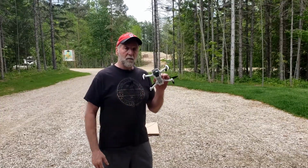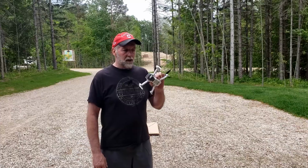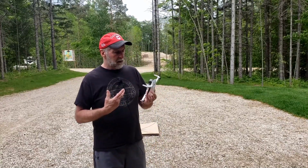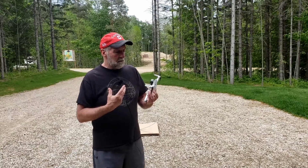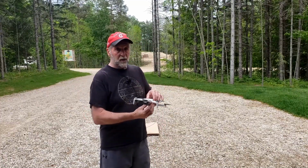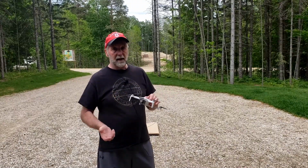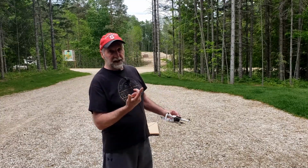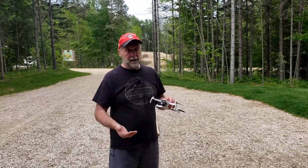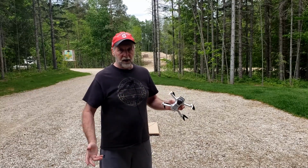So yeah, there are a few more updates to do, some little calibration errors to fix, some software issues to update, some instructional videos to put out, some tutorials that Fimi has to put out, some more documentation they should be putting out. Someone who just bought this as their first drone and tried to do a compass calibration without seeing any of my videos or anybody else's videos on compass calibrations or IMU calibrations would be pulling their hair out, because you can turn this thing as much as you want and nothing's going to change. And it doesn't change the way the instructions tell you. But we found that just 4 times horizontal, 4 times vertical, it changes and you can go ahead, okay?